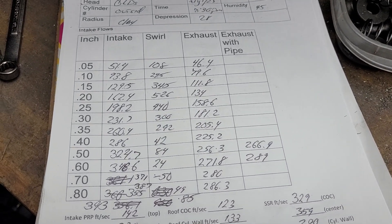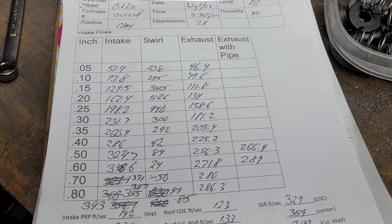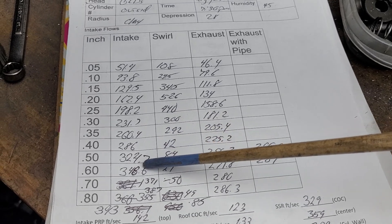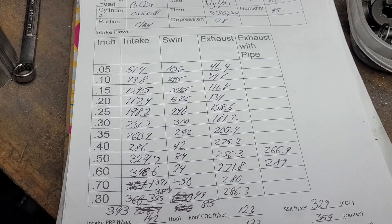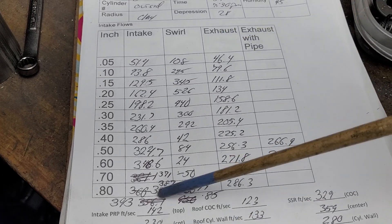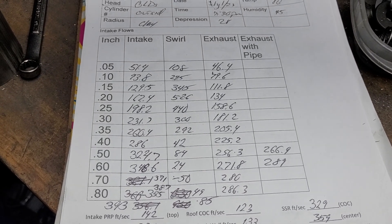The only thing I've done that comes close to this are those 9-degree small block Chevy heads — they had about the same size valve on the intake, but a smaller exhaust valve, just a 1.6, because it's designed for a small block chamber, and the bore would be smaller. By 0.500 lift, we got 324 CFM — not bad. I think these flowed more on his bench; he may be upset when he gets a look at these. But I'll say it again: not 100% accurate. Anytime you've got leakage on the bench it's going to skew your results, but I did the best I could.